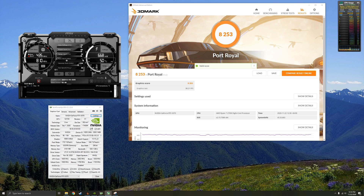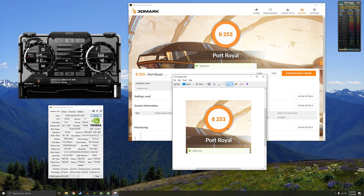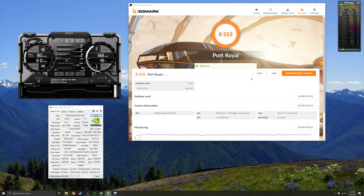I could step the core clock back down to 100 MHz since we know that passed fine, and try running at plus 1250 MHz memory. We can run it with these settings one more time to see if we get any artifacting. The score wasn't the best — probably the artifact penalized us or slowed down the GPU during error correction. I'm not sure exactly how they do error correction on non-GDDR6X GPUs like the 3070, which uses standard GDDR6. If we get artifacting again, we'll drop the memory clock down to 1225 or 1200.